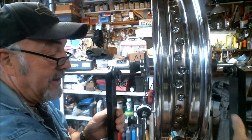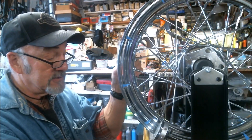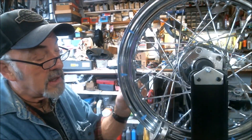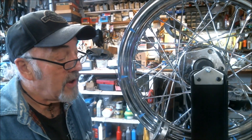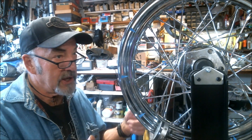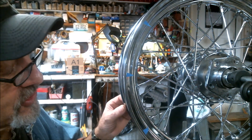Now we're ready to bring in the radial runout and the lateral. Radial runout is very close — maybe 20 thousandths. Lateral runout takes a little tweak; it's about 50 thousandths, so we're about 20 thousandths out of spec. We'll try not to move too much of the torque on each nipple and bring it closer to our 50 inch-pounds all the way around. Trued the wheel back up, got it in spec, centered without moving any nipple more than an eighth of a turn.